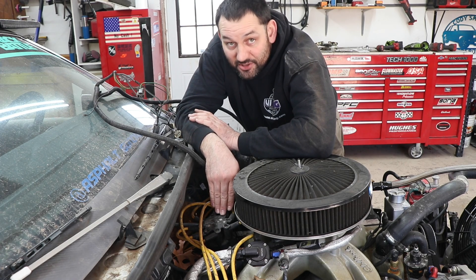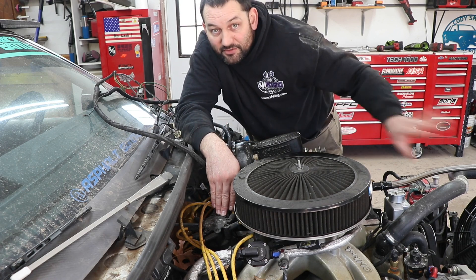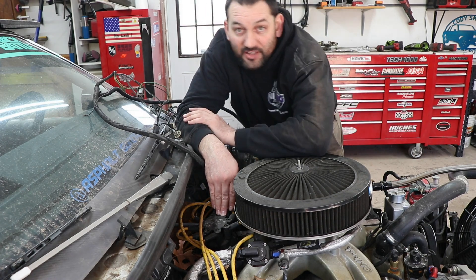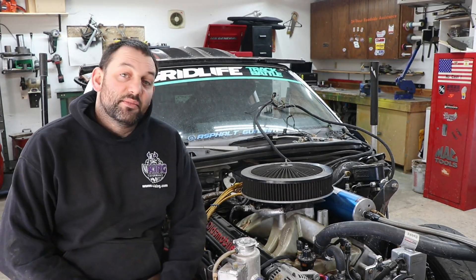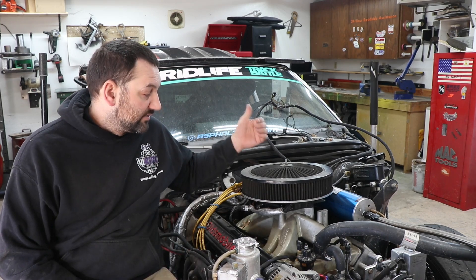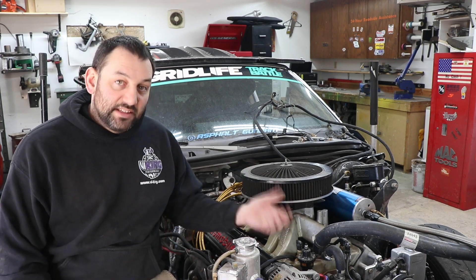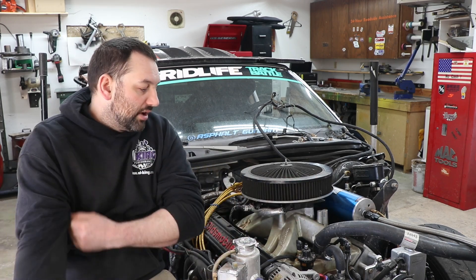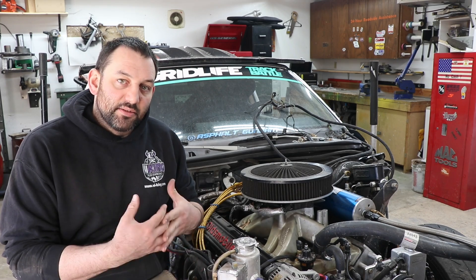It's a great place to start and it's a cheap easy thing to do — a lot less work than starting to try to change radiators and water pumps only to find out that's not the problem anyway. Next would be the carburetor for the same reasons. You can have jets get clogged up or metering circuits that get plugged, and if the carburetor is not giving the engine the proper amount of fuel, it will be running rich or lean. If it runs lean, it will cause an overheating problem where it's just building more heat in the cylinder than it really should be.